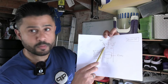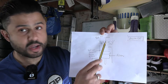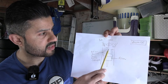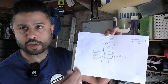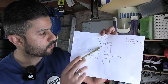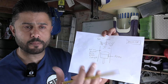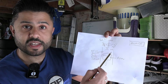You've got fuel being injected into the chamber, and you've got oil that's being injected into the chamber as well, and then you have the spark which causes detonation. When that happens at a normal point of the combustion cycle, the fuel has atomised, so it doesn't mix with the oil, and you get your normal detonation. However, when you have low speed pre-ignition, the fuel gets into the chamber, it hasn't had a chance to atomise, it mixes with the oil and creates a third substance inside the chamber, and that then causes pre-detonation.